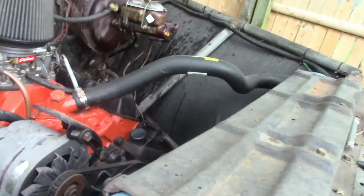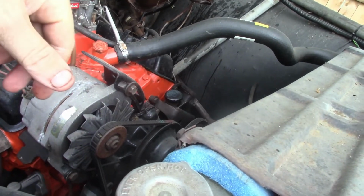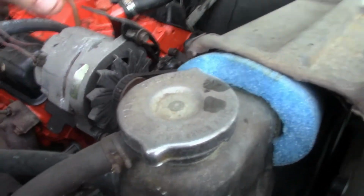And then the back, we got the wheel cylinders to bleed out. And that one over there on the driver's side, man, it had a ton of air in it. But we got it all to bleed out. Next, I've got to get some fuel in it. Made a mess with the master cylinder. We actually ended up re-bleeding it, then bled the system out. Got each wheel bled.